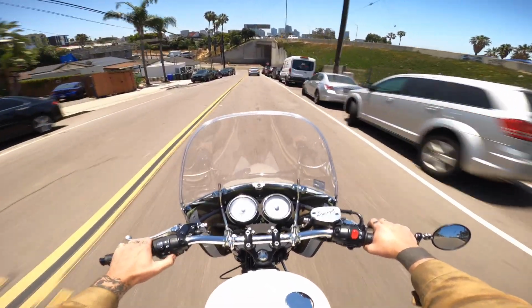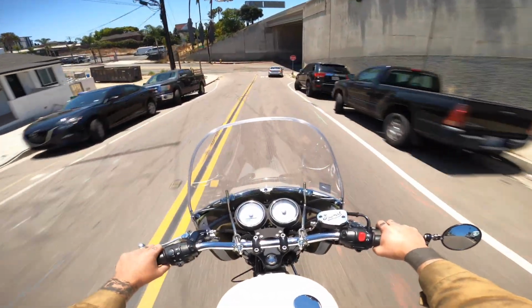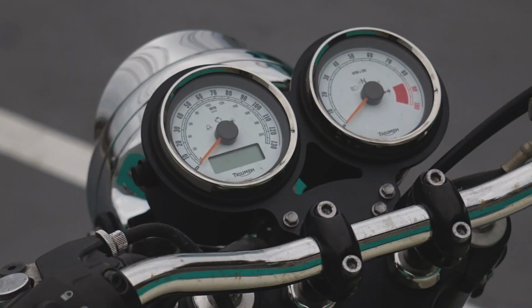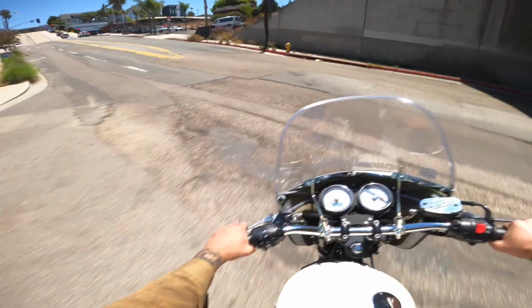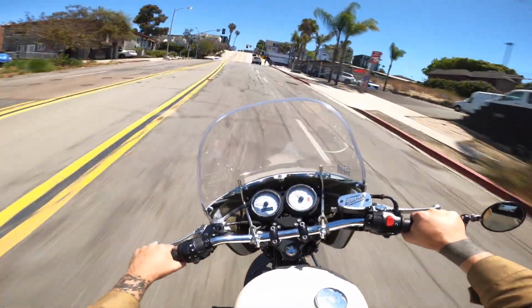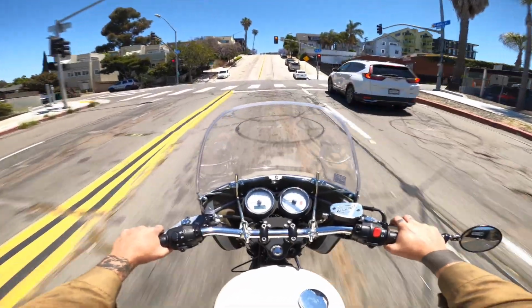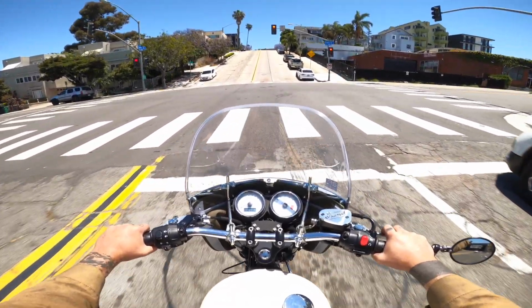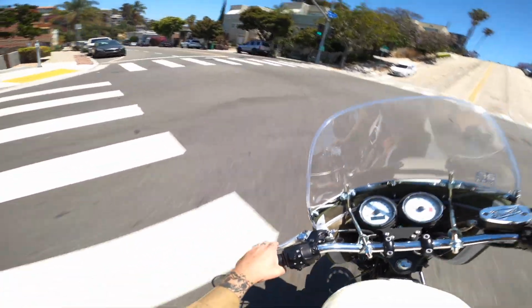I also switched the dash bracket thing that holds the gauge pods. That's from Motone, it's the lay flat dash. And I also got a low profile headlight bucket. It's another 7-inch bucket, I think it's a stock diameter, but it's just much more shallow and less bulky looking. There were some electrical components that would not fit in the headlight bucket because it's shallower, so they're just kind of wrapped in electrical tape. And I got the Asahi windshield kind of whimsically recently, but once I installed it, I realized it's perfect for concealing all that stuff.